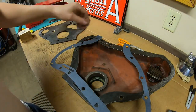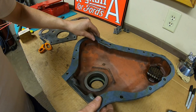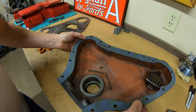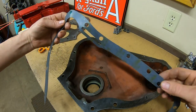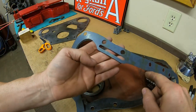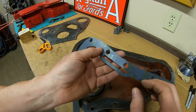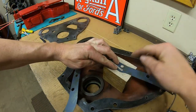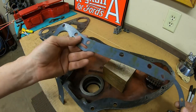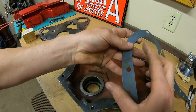We'll keep the center scrap because there are a lot of smaller gaskets still in there — that's still a very viable piece of material. Checking our end result — all the bolt holes line up just like they're supposed to, and that oil slot is right where it needs to be. Here is why I prefer to punch out all the through holes first before cutting any of the perimeter shape: you get to thinner areas like around here — if I were to cut this perimeter edge out first and then start popping holes in there, there's not a lot of holding material. Setting that on the wood block and pounding a hole punch through could very well tear and split it open, ruining the whole gasket. With the holes in first, you've still got plenty of surrounding material, it adds strength, and you can slam holes wherever you want without worrying about blowouts.